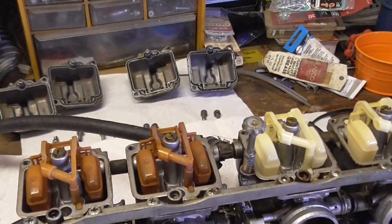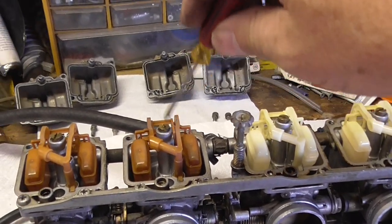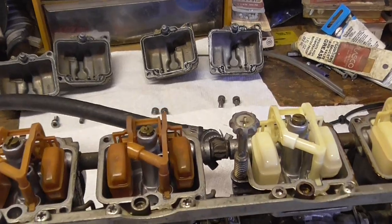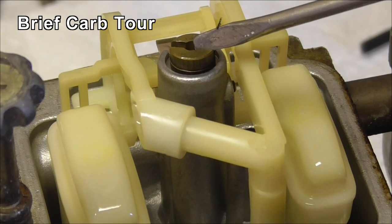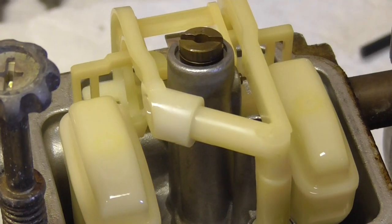Spot the 2 new floats I've had to put in over time — the white ones. They turn this brownish colour after multiple years of exposure to our nasty fuel. That's the main jet. If you unscrew that one, down inside is the needle jet.